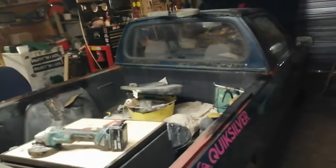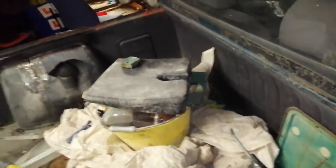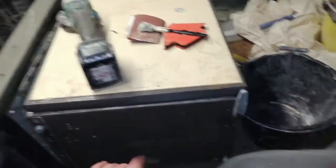It's got MOT for about a week left, so this is all MOT work. The clutch is really, really high — like, I've never driven a vehicle with such a high clutch. It's literally on the last quarter of an inch from the top and it just jolts away. Something tells me someone's adjusted that all the way out to get it moved, so we'll put a clutch in it. But it's a straight diesel pickup truck — it's not going to be hard, and they're not expensive either. So we're not worried.